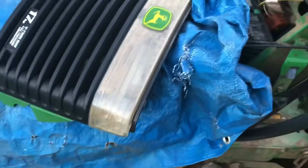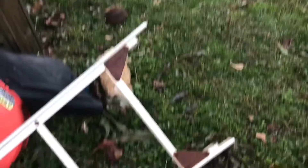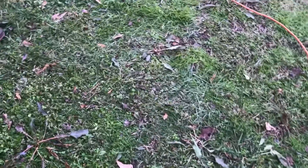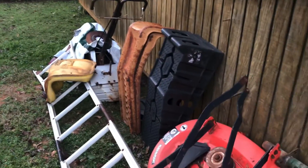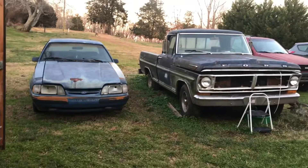If you'd like to see more videos on this one too, let me know. I want to hear your feedback on everything I'm doing and how the videos are going. I also got a tiller this year — got it for 20 bucks. It runs but the pulleys have so much rust on them they can't spin freely, so I'm going to have to clean the pulleys off. The back tire is rusted onto it so we're going to work on that. I'm going to try Mr. Taryl's heat-and-quench trick for removing rusted-on objects, and I think I've got enough gas in my acetylene torches to make that work.